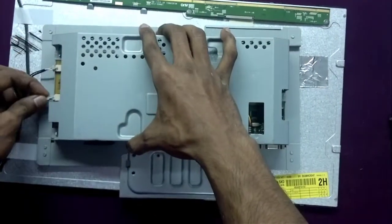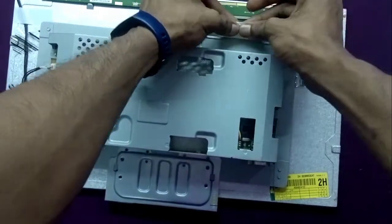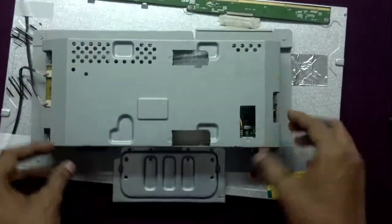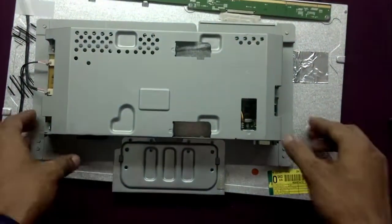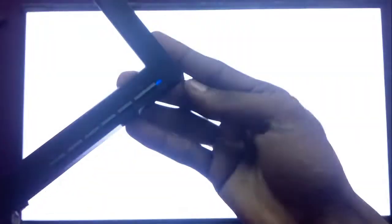Let's connect the power supply to the backlight to do the test. We will cover the display ribbon cable to prevent it from shorting on the body. Next we will connect the power to the power port. Let's turn the monitor on — hooray, it was a success!